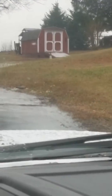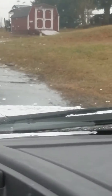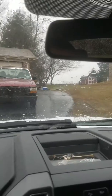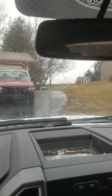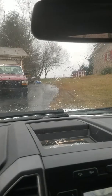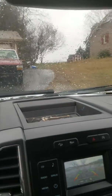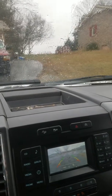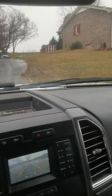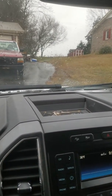One way that you would use this is, say, in the corner of the yard — it's raining a little bit here. That's my parking area, and I have my other Ford there. As you can see, one wheel is going to go off the pavement whenever I park there. You don't really want to use four-wheel drive on dry or wet pavement because it will bind up as you're turning.